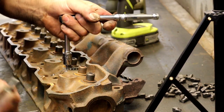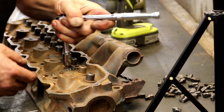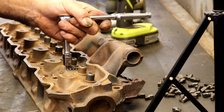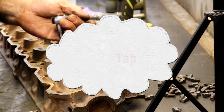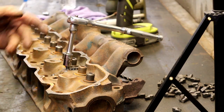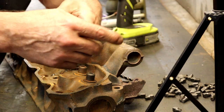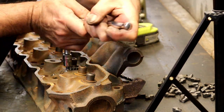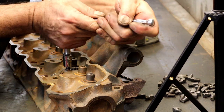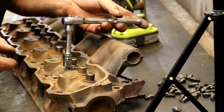It's a tapered plug, it's actually like a pipe plug. That's how you seal water pipe plugs, even gas fittings, with a tapered cast iron plug. So if you're in an area where you can't get any of this stuff, think about it. Buy the smallest pipe plug, pipe drill bit, and some plugs, and get after it. What's the difference here? We have a tapered reamer that actually reams the hole at a taper before we even tap it. But if you were to drill with a small drill bit and then start using a pipe tap, that could most definitely work. And with a bigger pipe plug, you'd have less of them in there. I'm saying if you've got an old tractor, you're somewhere where you can't get to the internet, then how would you watch this video? Well, you know what I mean.